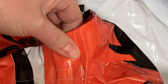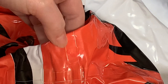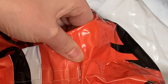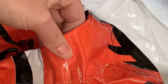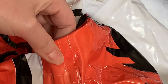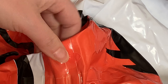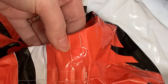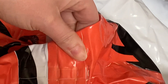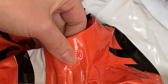Make sure to press the patch on really well and leave it for a little while to dry. Come back and make sure it's all down with no air bubbles. Let it dry, then gently inflate it and double check to make sure it doesn't come up and there's no leaking past the patch. That's pretty much it — it's just a standard patch, you just have to take some of the print off before you can put the glue on.